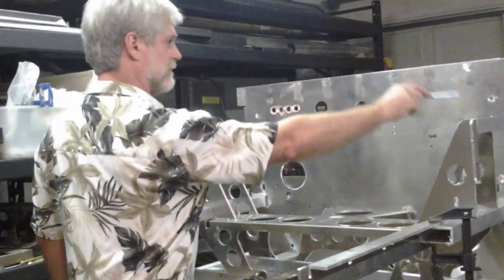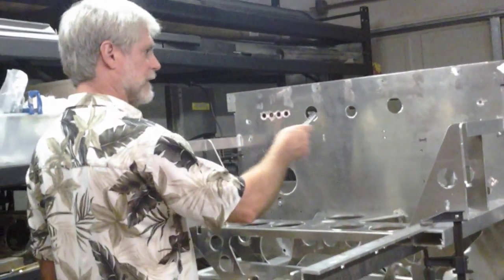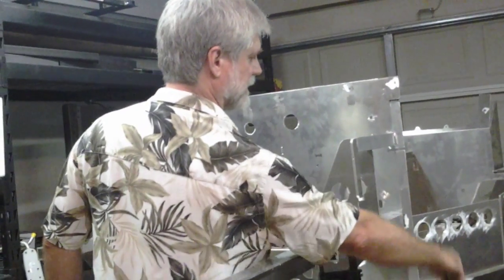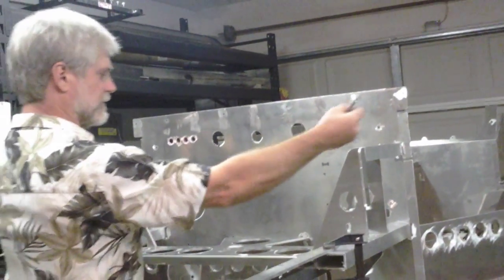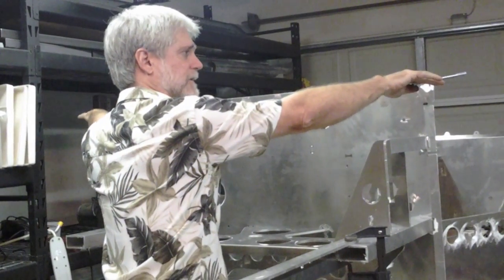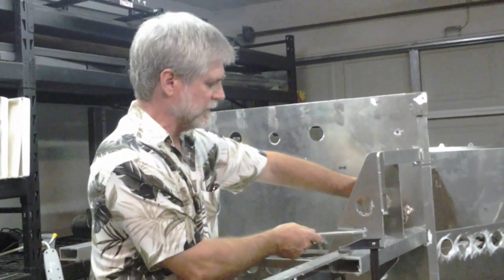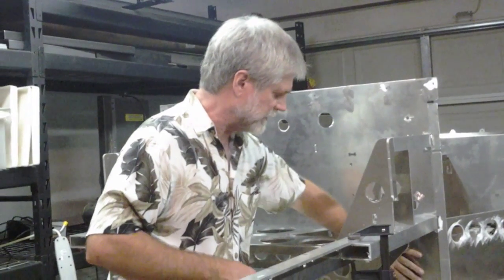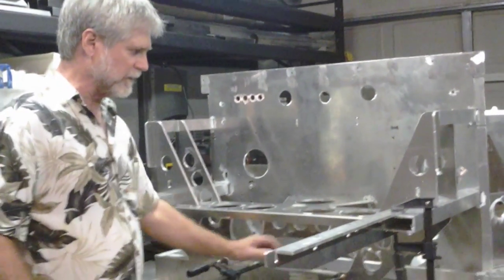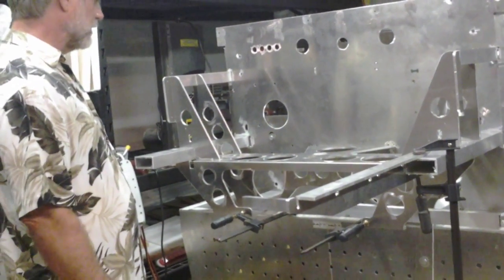There's another bar that comes like this that I have not put in yet, not cut out. But that bar does numerous things - the shock mount goes right here, that's what this tower is for, it catches a shock. It also comes up and supports all the dash, plus comes out and supports the bars that go out to support that big door hinge. A-arm points here and here, A-arm points here and here, A-arm points here and here - it's going to be a rack and pinion arm that comes out just about like that. I've done all the geometry on this thing and all of those points are exactly where I want them. This is starting to look pretty cool.